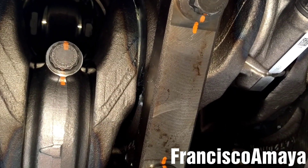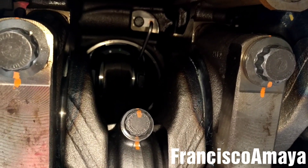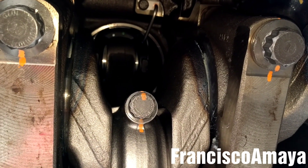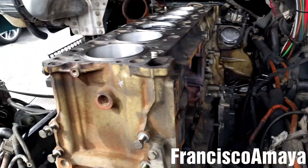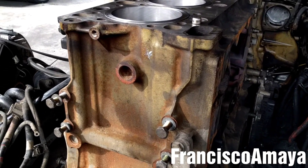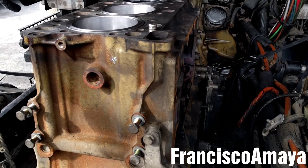See how close the nozzle gets to the piston pin — that's extra lubrication for it and for the cylinder walls and other components. Double-check that you haven't forgotten them, because many people do and it's so important. If you don't install them you'll damage the engine. With everything done, the job is completely finished and we are ready to install the head back and finish the engine.